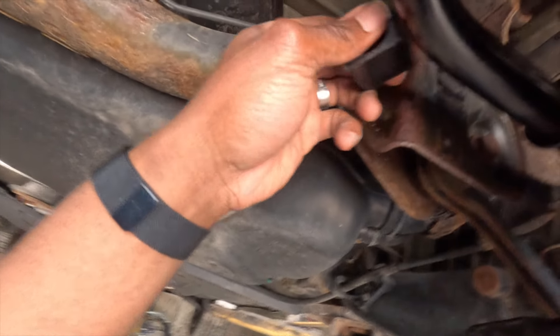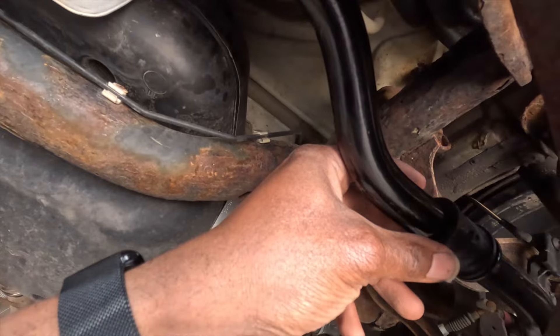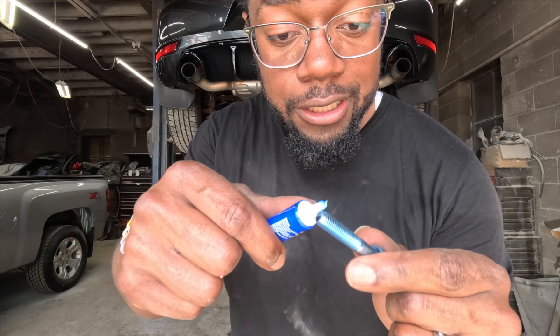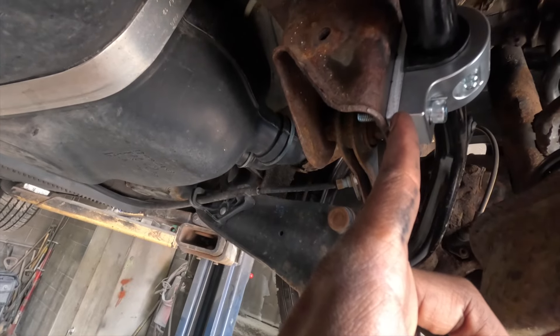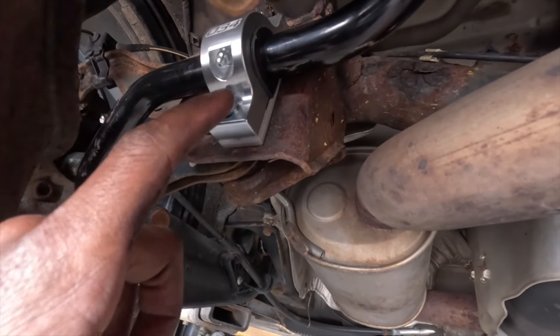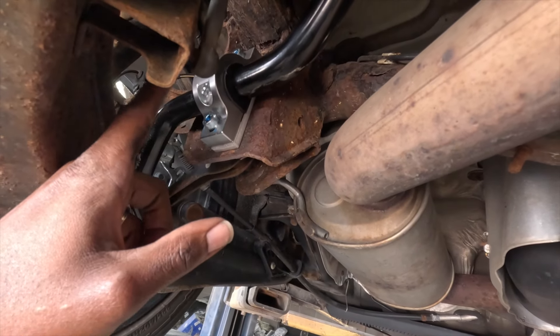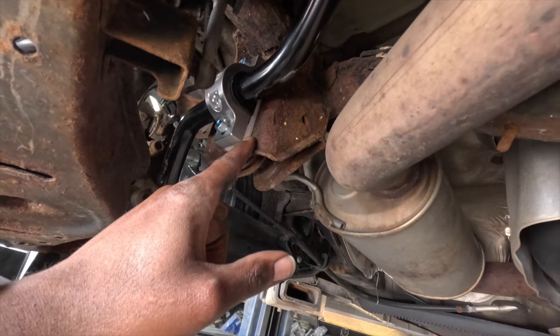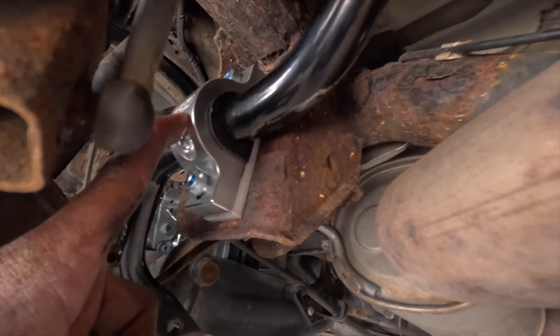Coming over to the car — all you do is put the bushing on there, this piece just opens up and you slide it into place on the inside. Now we're stepping outside the shop to apply blue thread locker on the tips of the nuts before tightening them down. The bracket piece goes in between, and always make sure your zerk fittings are facing downwards so you can add grease to them later. The bolt with blue Loctite goes through a washer and then to the bracket, and there's a flat rectangular bracket behind that piece so it sits flat.